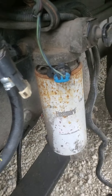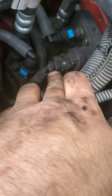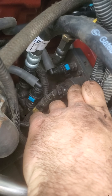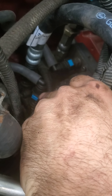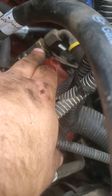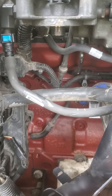This fuel hose right here comes off the fuel water separator, which is going to be replaced too. Up in here you can see your high pressure fuel pump is bolted on the back of the motor — unlike the light duty truck version of this motor where everything's bolted on the front. So you have your fuel tube coming in, two fuel tubes coming out, and then your fuel return back in there. I'm also missing the fuel filter here — that's going to be coming in this afternoon.